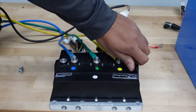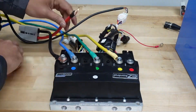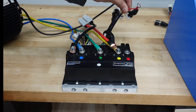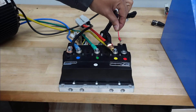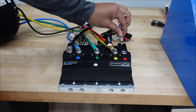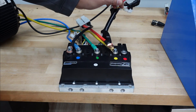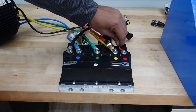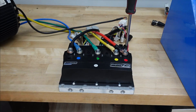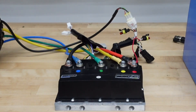Next, we're going to connect the red and white terminals coming out of the battery. Before putting the positive on, note that the e-lock switch also goes on the positive terminal — this is important. Your motor will not turn on if this e-lock switch is not on the positive end.